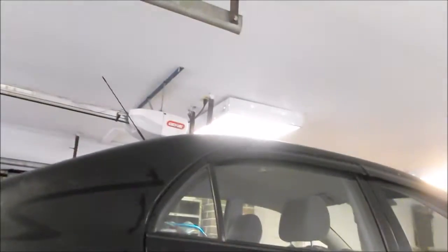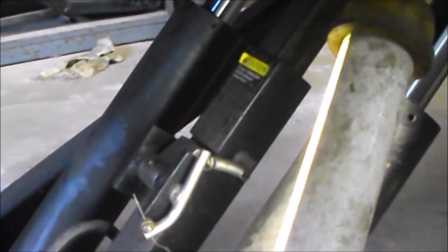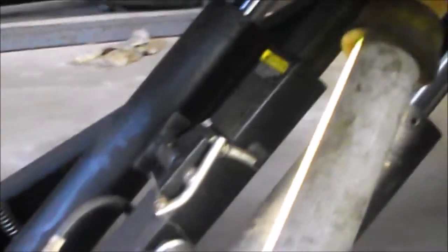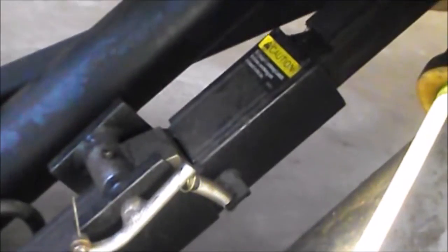If the car seems stable on the hoist, then you should be able to raise it the rest of the way. While you're lifting, watch your roof to make sure you're not going to hit anything. One key piece that's important: make sure the safety is engaged. It's not locked right now, so we should raise it up until it hits the next lock point. Now the lock mechanism has dropped in, so we want to lower the hoist down until it engages the lock mechanism.